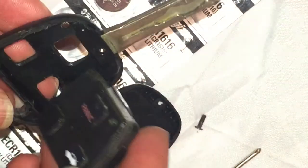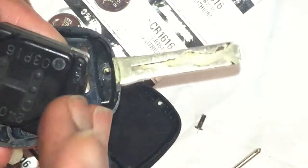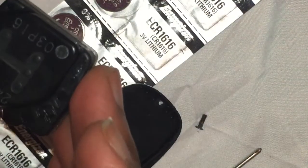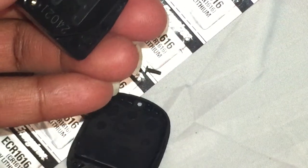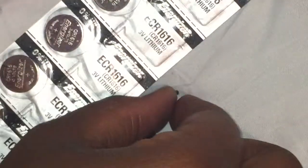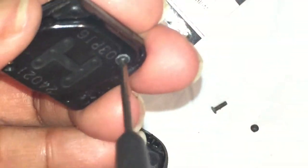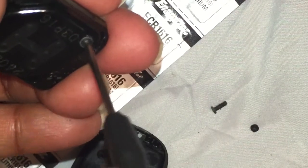I'm going to dismantle my key here. I'll get that same tiny Phillips screwdriver and unscrew screw number two. I always remember lefty-loosey, righty-tighty, so I'm going to unscrew it by turning to the left and remove screw number three as well. Make sure you keep up with your screws — the first one you remove will be longer than the second and third screw.